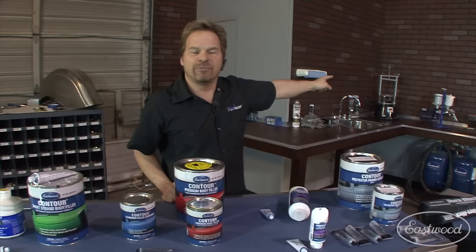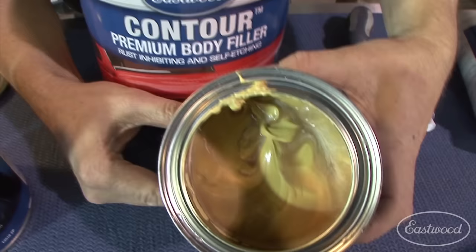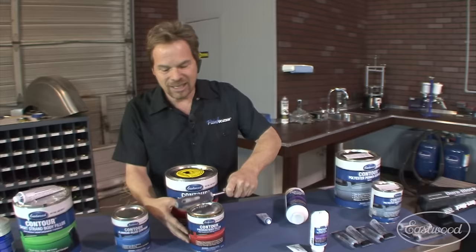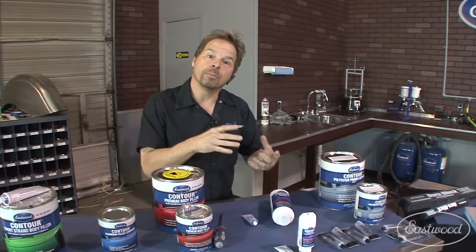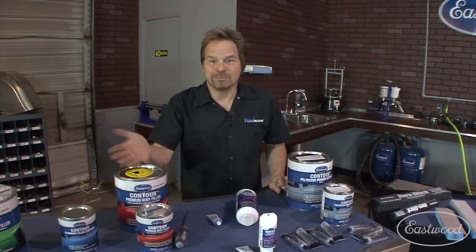So why did I have my filler on the shaker? I had it on the shaker because of this — this is resin technology, that stuff floats to the top. This is not anything bad about the product, it's the nature of the beast. The resins separate. This stuff might sit on a shelf or in a UPS truck for a while. That particular shaker doesn't agitate to where it's going to aerate — by aerate I mean add bubbles. It agitates to shake the bubbles out and intermix the resins that float to the top, and get it ready for you to apply.